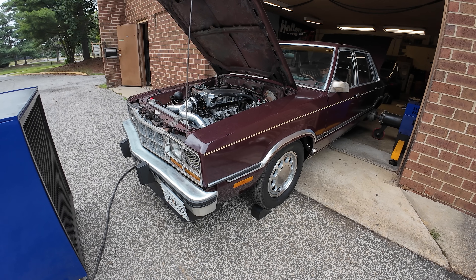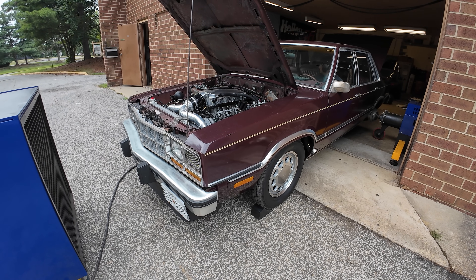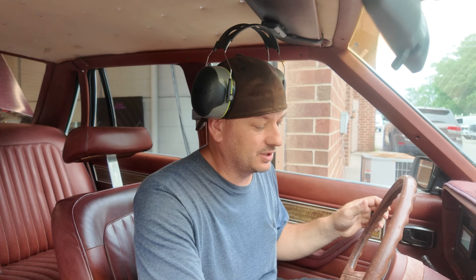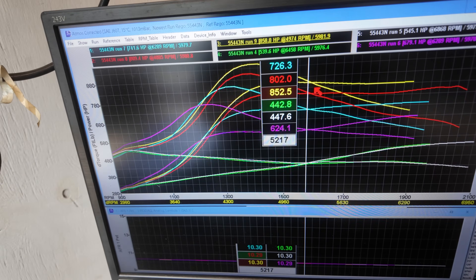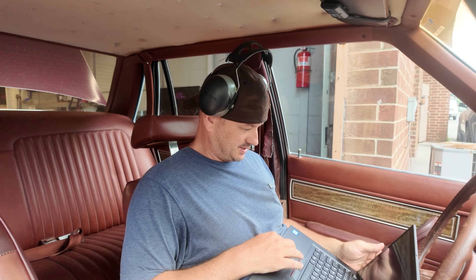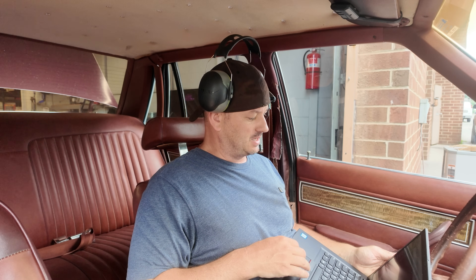858. I didn't rev it quite as high because I got into the rev limiter last run, so there's a little bit of a complaint about it. The million dollar question is usually what's the next move — more boost or more timing. We picked up like 50, so we're going to put some more timing in. Other than the brief boost spike, the fueling is absolutely perfect: zero, zero, zero, one, zero, one — basically spot on. The target air-fuel ratio is pretty rich too. We'll try a little bit more timing on this one.